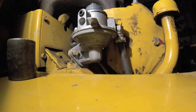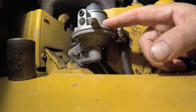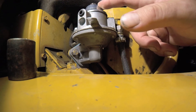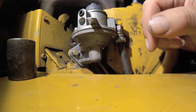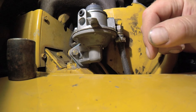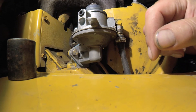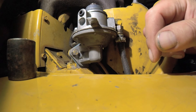Step two, three, or four of troubleshooting has definitely been verified — this fuel pump is not pumping shit. Fuel is present here, it's getting actuated, there's a decent seal, and nothing's going back and forth enough to make fuel go out. It's definitely a fuel delivery issue. I'm gonna have to shorten up this video or shoot another one — we'll see how it goes. I'll keep you guys posted. Pretty sure this is the culprit. God damn it, I wanted this thing to go. Anyway, thanks for watching — peace.